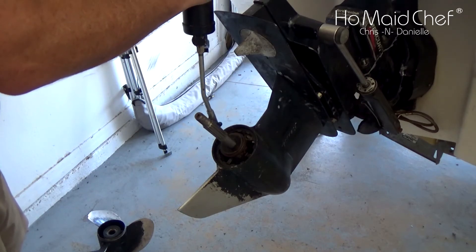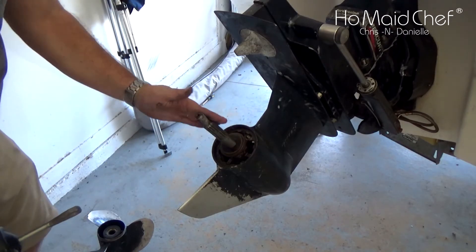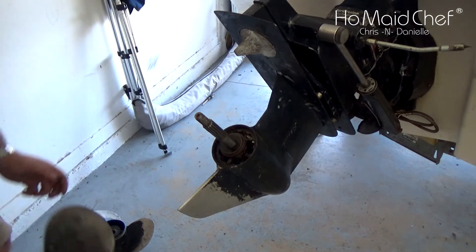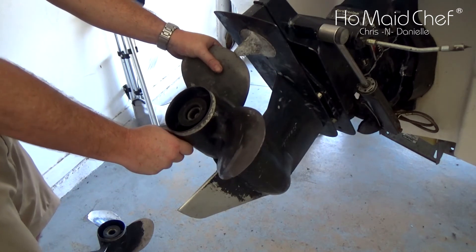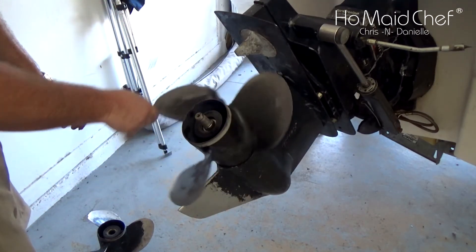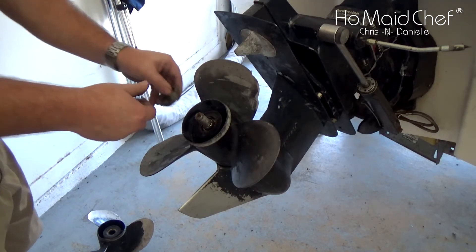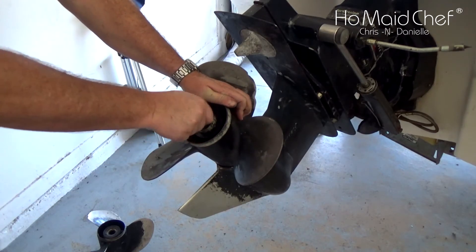I'm going to end up using my hands. Fill that all up with grease so next time it comes apart easier than what I had. Then you slide your bigger prop back on — slides over like that, make sure it spins. Then this piece right here — I still have grease on my fingers — I'm going to rub my grease in there, slide that on there like so, and then twist this guy out.